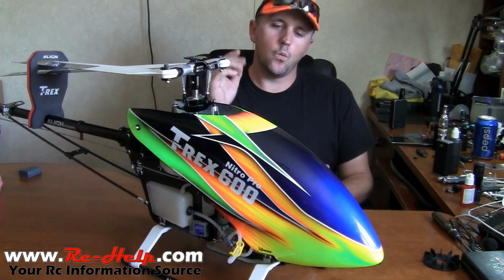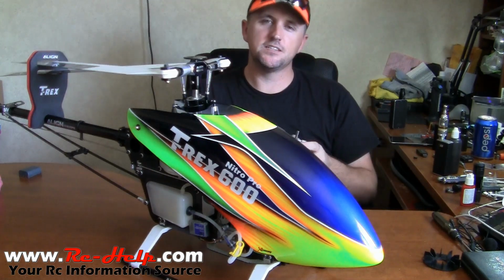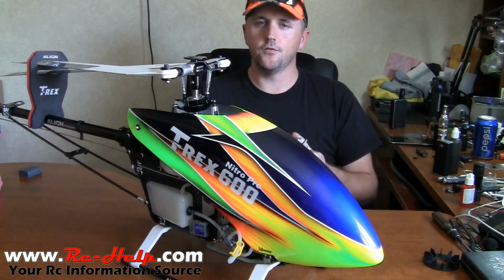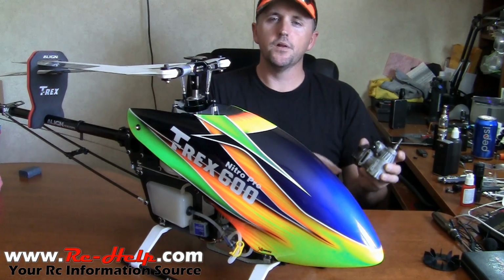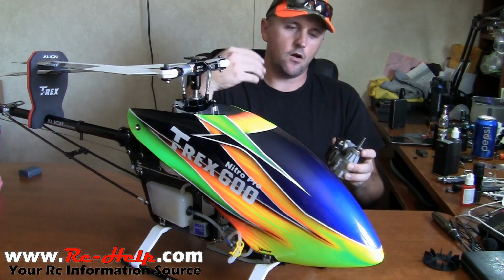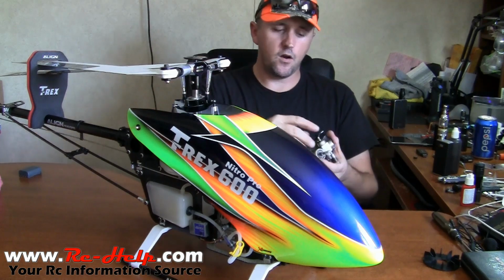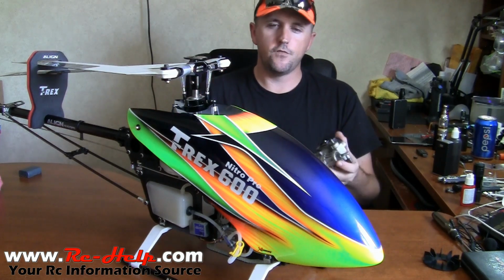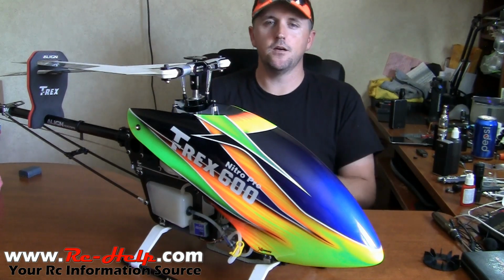In today's video, we're going to set the throttle linkage on this. As you guys know, I replaced the engine in the 600 Nitro, and the arm on the carburetor is just slightly different. So I've got to loosen the arm on the new carburetor, and we have to completely set this thing up again. We got to set our high points, got to set our low points, and we also need to set where the carburetor is only halfway open. That way we get equal throw going back and forth. This will help us in the next video where we go in and we set the governor up.